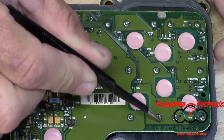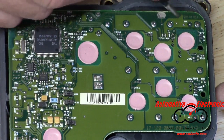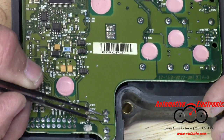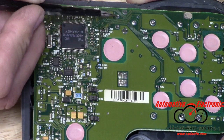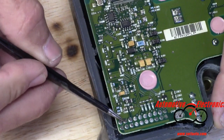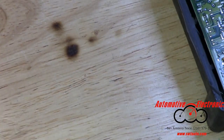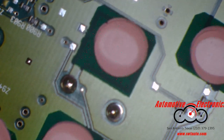You've got some points on here. Sometimes there's like four in a row over here; sometimes they're staggered like this one. This one's got four in a row on this side, and on the other side they're staggered. You want to resolder all of those. The header pins here where your connector connects in — you'll want to resolder all of those as well. Maybe perhaps even these two right here in the middle.